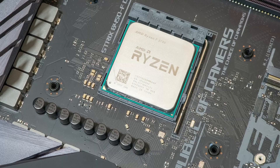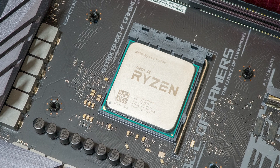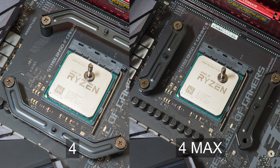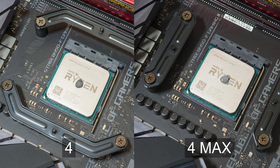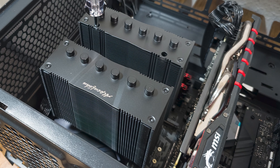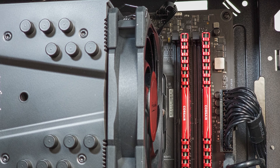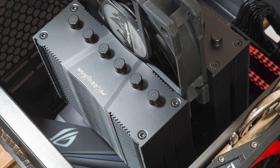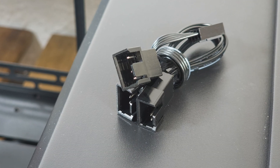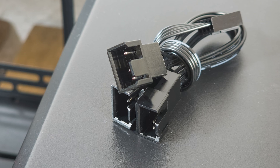The first step is to remove the stock front plastic brackets from the motherboard while retaining the included backplate. Then attach the black plastic spacers and secure down the metal plates as seen for each model. Apply the thermal paste with your own method of dispersion, then bolt down the heatsink via the two securing bolts. Finally attach the fan and combo set respectively and connect them to the motherboard. Since this motherboard already features two CPU fan ports, the included splitter isn't necessary on this build for the Brocken 4 Max — but keep it, as it will come in handy one day.